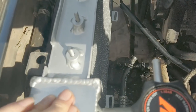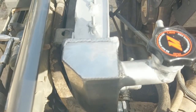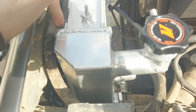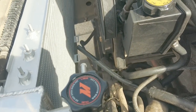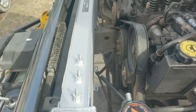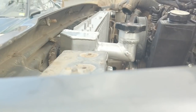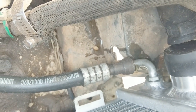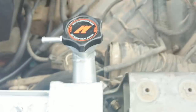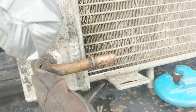So now you can connect your condenser to your rad if need be. It comes with brackets but not hardware. On the other version there was just a little tab sticking in and I just used zip ties — worked really well, honestly. So we'll figure out something to do with that, but we'll get our connections in and then drop the fans in. Actually, if you look you can see this side is higher than that other side — that's the lower hose getting in the way. Notice we have contact on that cooler line; I had the same issue with the copper one on the old rad but I was just able to bend it a little bit.